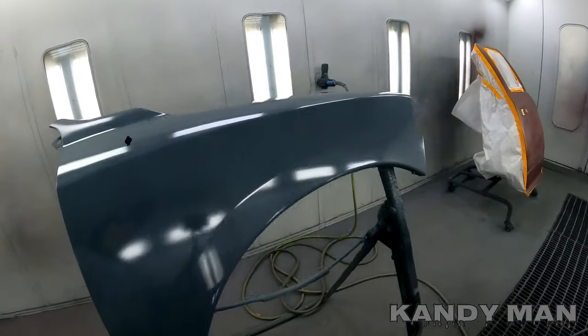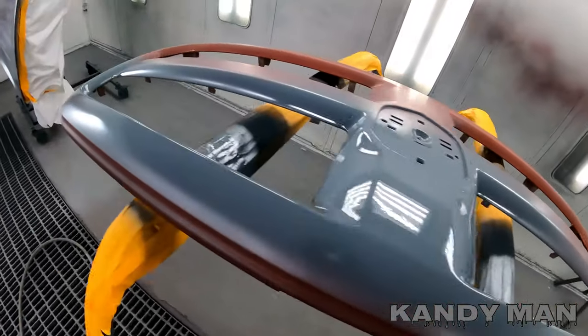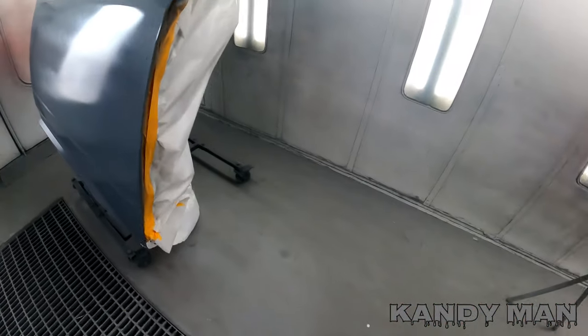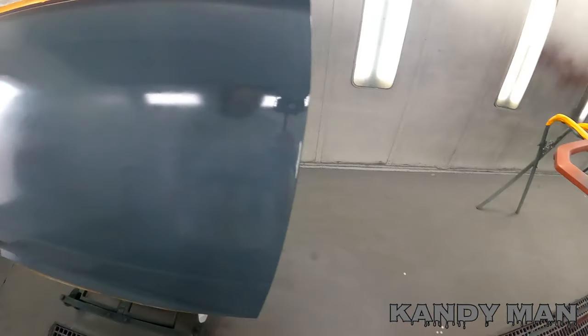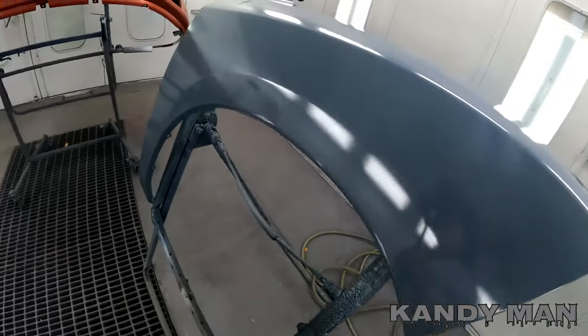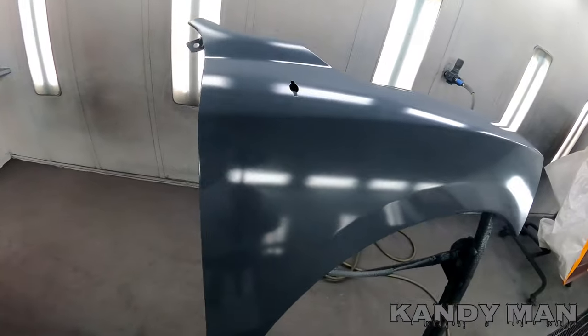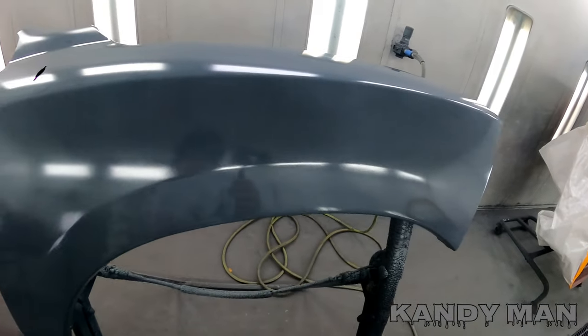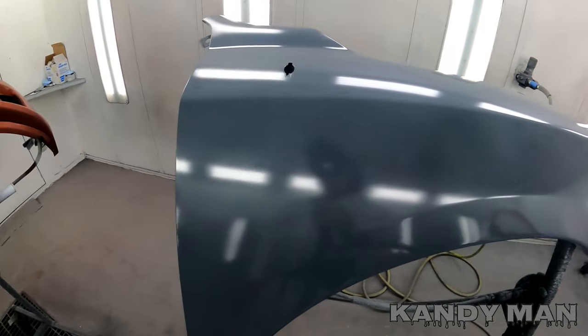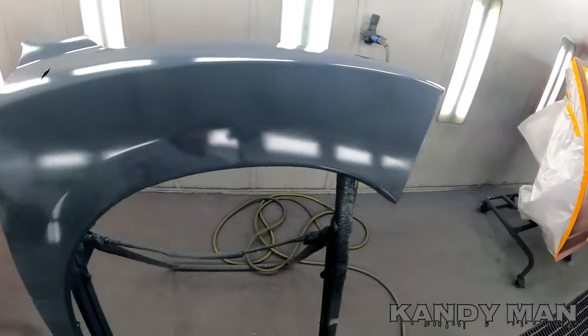Sealed up on our new part, and on our repairs we put sealer, which is a solvent, over the top of the repair area. And I do that even if I finish off my body work real smooth, I always seal it because I like the way the water base lays over the solvent and over the sealer. So I don't like just painting over my parts because you'll have a better adhesion with the sealer, and they recommend that with the Sherwin.